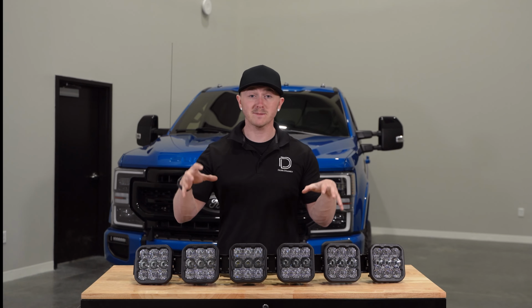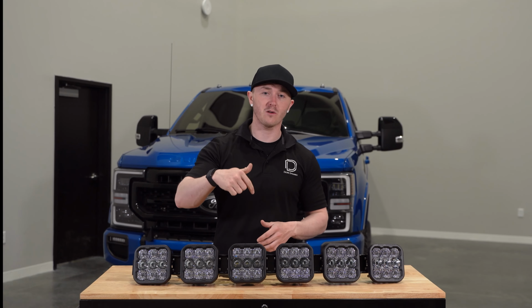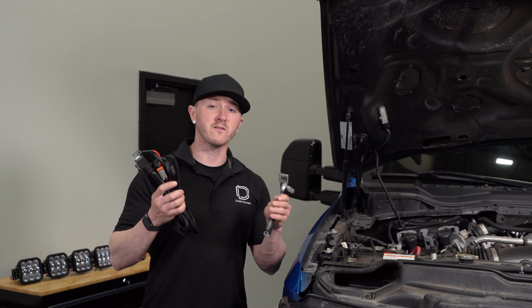Moving forward, we can now assemble our SS5s into our CrossLink Lightbar. If you need assistance with this process, we have a full video linked in the description below. And it's important to note for this kit, since it's a slight curved configuration, we'll be using the second notch on our CrossLink. We're now ready to move on to our wiring.